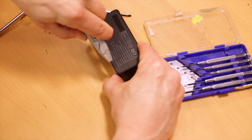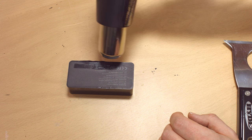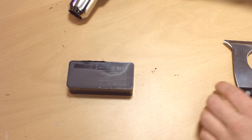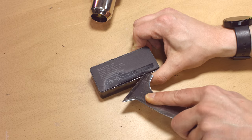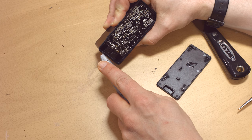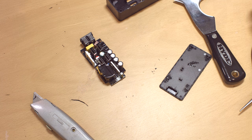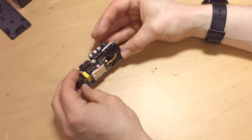Watch this sort of separate part of this episode of Let's Quickly Open. I had been hoping that the bottom cover was simply latched into the case, but after a couple of minutes of prying it became clear that it was probably glued or welded. I broke out the heat gun because I figured that in either case that might help loosen it up, and it beats the mess made with the Dremel. After a couple of minutes I managed to get decent purchase and leverage using a 5-in-1 tool and popped off the cover with a bit of force. It looks like it was welded at about 18 spots all the way around. The circuit board wasn't held in with fasteners, but it was held captive by a small lip of plastic under the power connector.